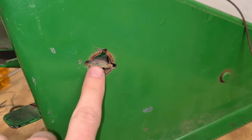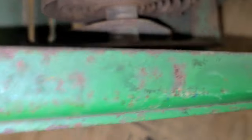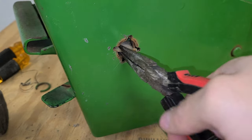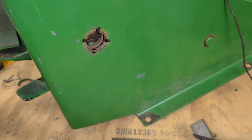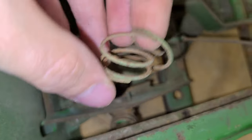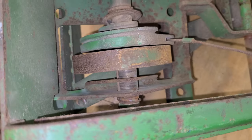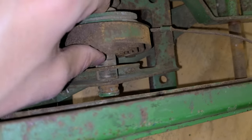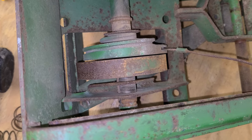This piece is actually holding on the spring. We're going to twist this out using the slots there and see if we can pull this out. The old spring ain't what she used to be — she just kind of fell apart there. We'll pound out this shaft and take these pieces off one at a time.